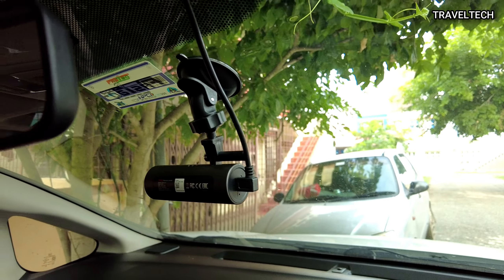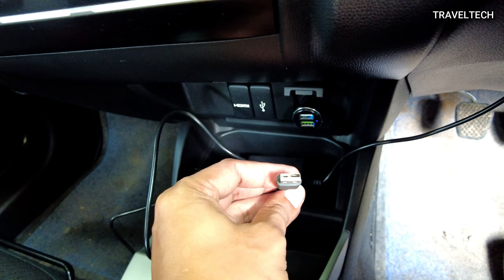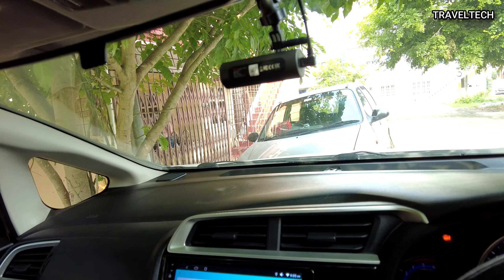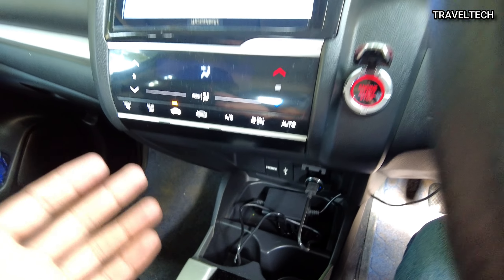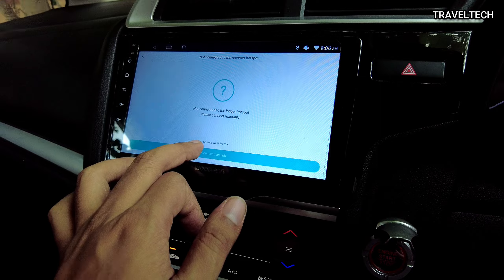I have now connected the power cable to the dash camera and brought the USB-A connector down near the dashboard. Here is the power adapter for the 12-volt socket — I am going to connect the USB-A port into the 12-volt adapter. You can now hear the audio prompt of the dash camera, which indicates that the dash camera has started via the parking monitoring kit. Place the kit in a proper safe location — for the sake of this video I am just keeping it nearby. Now connect the dash camera to the 70mai app.